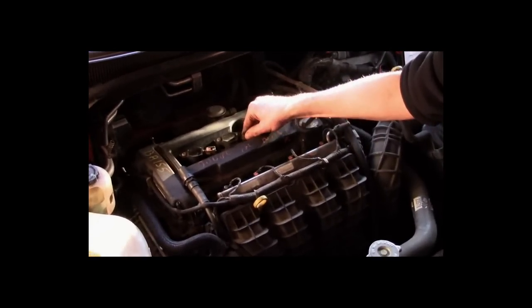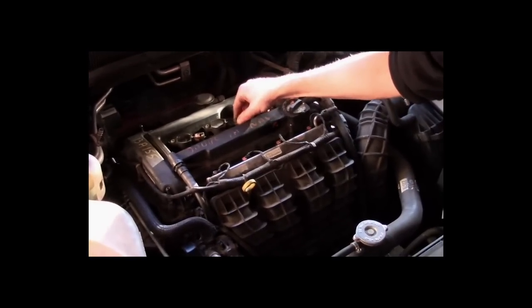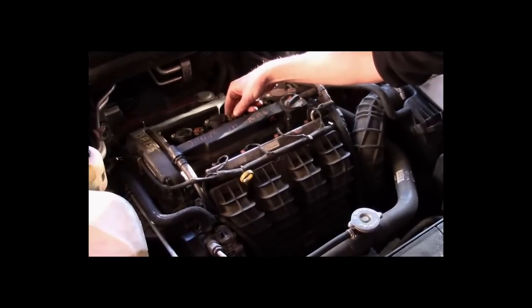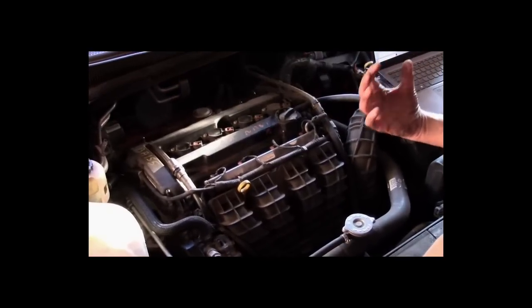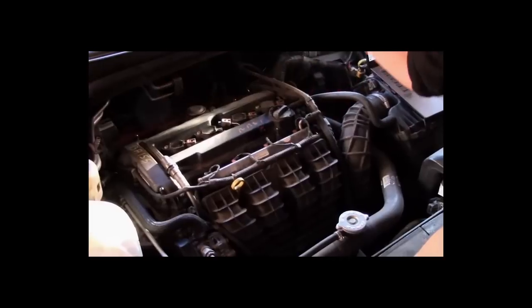There's a little difference. So I don't think this is an ignition misfire. Notice, plug it in. Absolutely doesn't seem to be any change. I can tell you there's a very, very little bit of change, which makes me think that there is some contribution from the coil. Unplug it.